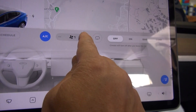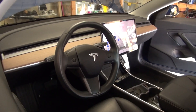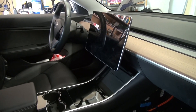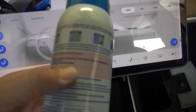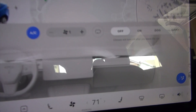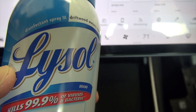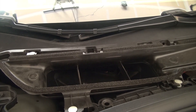After 20 minutes, you then run your AC at the highest level. I have all the windows open and I'm going to run this AC for the next two minutes. I completed running the AC for two minutes at the highest setting. The next phase is I'm going to spray this Lysol disinfectant. I'm going to open all the vents including the back and disable the recirculation so that the air can come in from the outside, then spray the Lysol. Mold, mildew, and bacteria don't only live in the AC evaporator — they can also accumulate and form in the ventilation system as well.